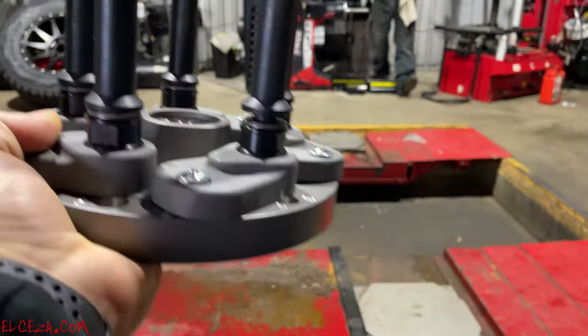Yeah. Have any of you ever watched a vehicle go down the assembly line in a GM plant? What puts the rotors on the hub? Big robot, right? Reaches over to the tub, picks it up, goes to the car, and does this. Pulls it off, rotates it, pulls it off, rotates it the third time, puts it back on, and then it goes to one of the three spots and zips the keeper off. What was it looking for? The minimum amount of lateral runout.